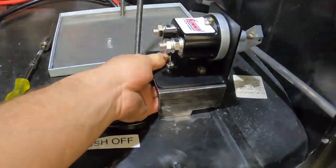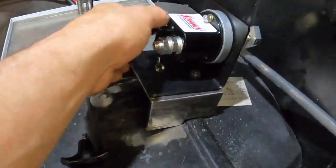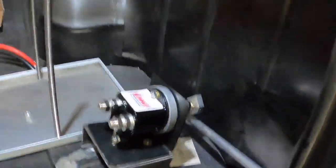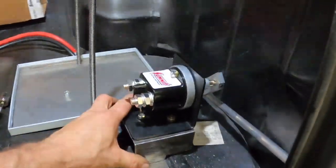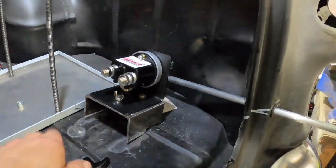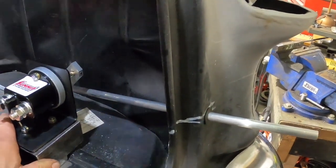I'm at the point now where I want to just set this in here. I notched both sides so that it doesn't interfere with the stamping right here. There's a little dent from whenever — anybody watching for over a year knows that was to get the quarter and trunk to fit good. Somebody suggested hydraulic force — it worked great but put a little heat. But it's all straight now. I'm going to get this lined up, put just a tack on each side, make sure the switch functions properly, and if it does we'll weld it out and then cut this bar to size.